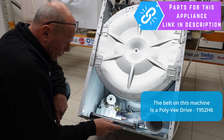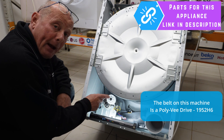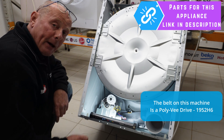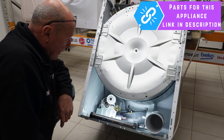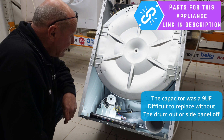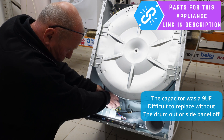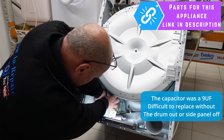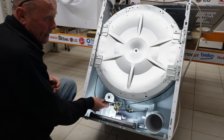Another thing to note: if you ever have a tumble dryer not turning correctly due to a capacitor failure, on this machine you still have to go with the side panel off to gain access to the nut to remove the actual panel. This machine is actually making me want to give up repairing appliances. To remove the belt, just pull on the pulley wheel or tilt the motor down, take the belt off the pulley wheel, and put it back — that releases the tension completely.